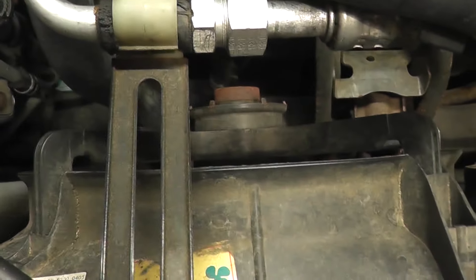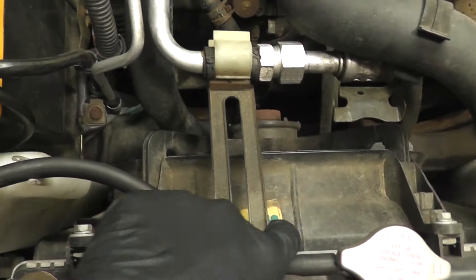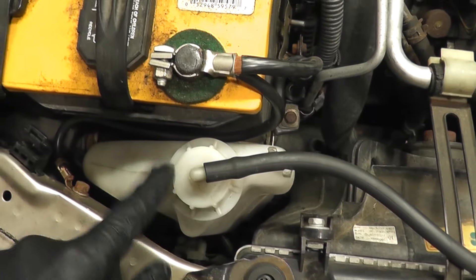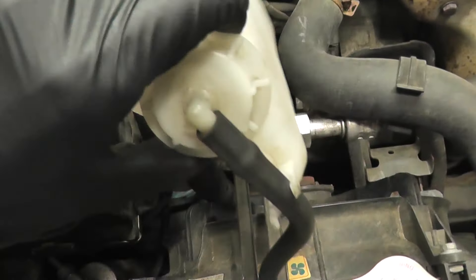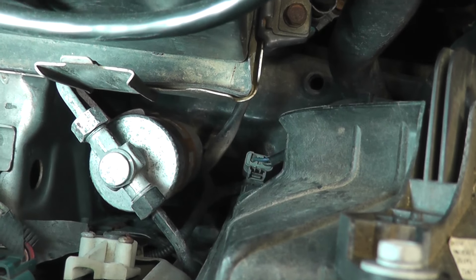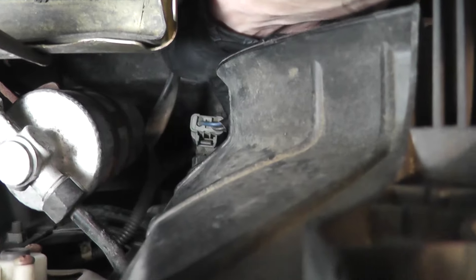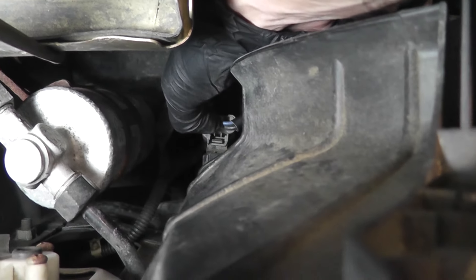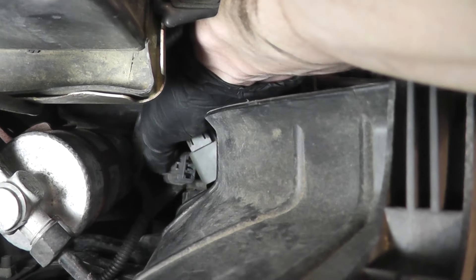What I'm going to do is pull the connector on the fan. I'll start with the radiator fan. The connector for this fan is down low under this coolant overflow bottle — it just pulls out, and right down there you'll see that two-pin connector. The back of the connector clips onto this bracket, so you pull back on this tab and then pull it off, then squeeze this tab and pull the connectors apart.